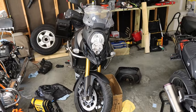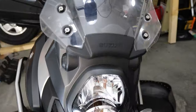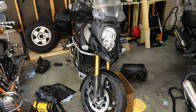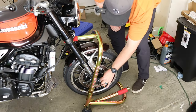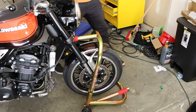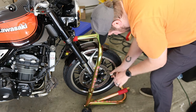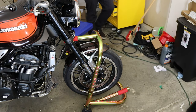Which is really nice because it's really easy to get. I don't know any bike that has a really awkward size that you have to special order from anywhere — definitely don't know any manufacturer that made my life more painful for no reason. There's one pinch bolt on the front wheel, which is a 6, is my guess. It is a 6. You couldn't possibly loosen your front wheel without taking that out. When we're putting everything back together, I will go in and check the torque specs. For now, I'm just trying to loosen everything.